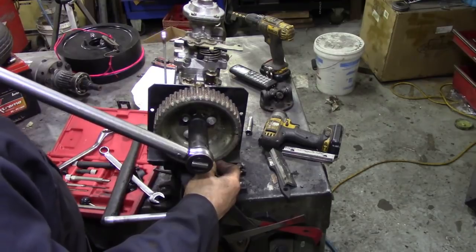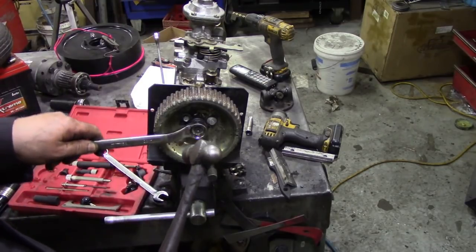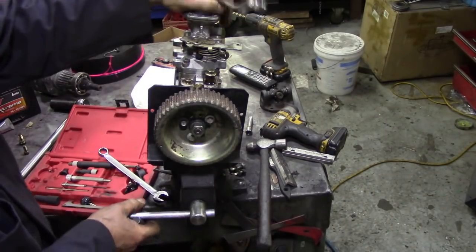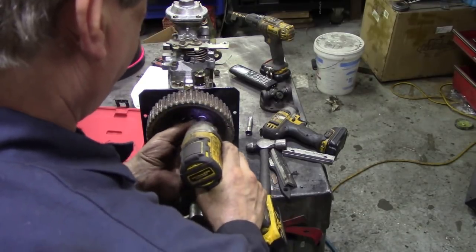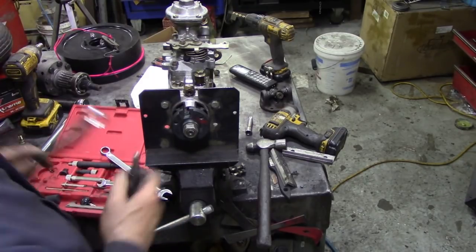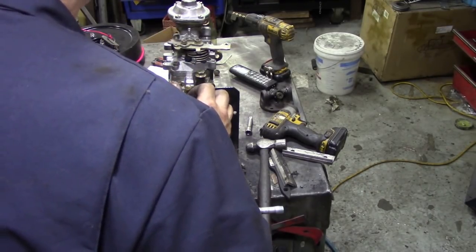It's supposed to be 90 Newton metres - oh, that's tight, tighter than I usually do. I need to turn this back a bit to get the pin out. The bolts here don't line up - this must be the camshaft one. Take that off, take that off, get your pin, turn the pin - and that is exactly 1.6 - perfect.